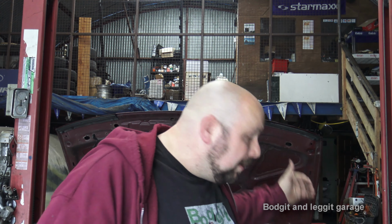Bear in mind, to do this test on a modern car, you could have to wait up to an hour before everything turns off before you can get a true reading. You'll often hear on modern cars a buzzing when you turn the engine off because there's things still on and buzzing. They might go off after 30 seconds, a couple of minutes, but there still might be other things that the car is doing. So bear that in mind. You'll see a lot of auto dimmer switches in the car, so when you close the door, the light could stay on for a couple of minutes, but if you lock it, it will automatically dim. So bear that in mind too. Don't do the test until the lights go out. It's common sense. But that's how you do it.